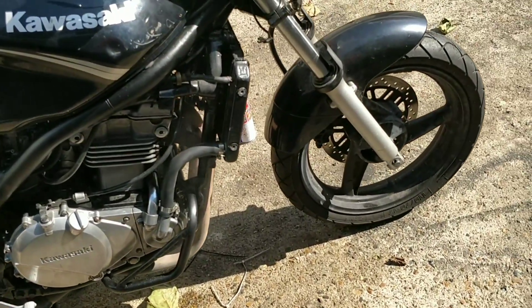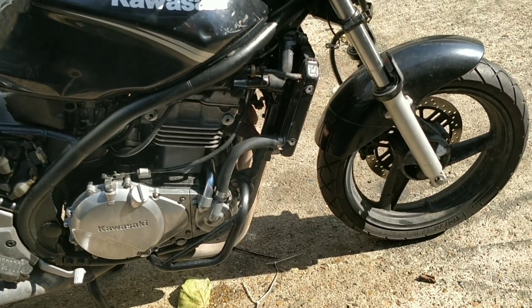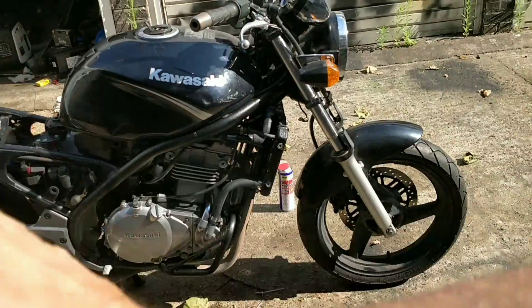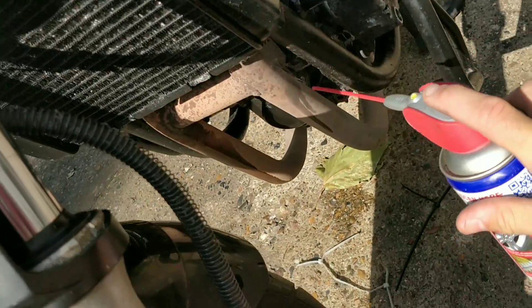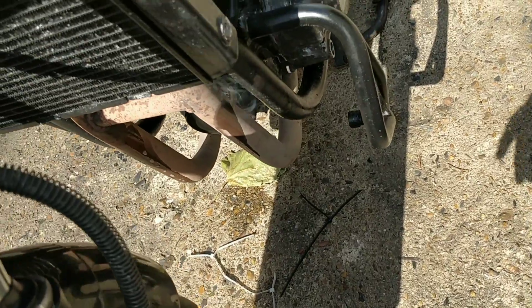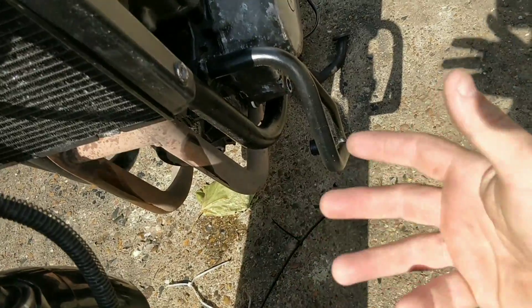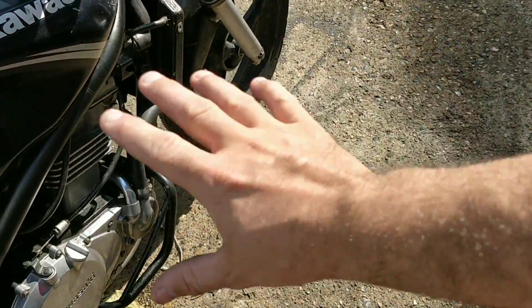I think that was running on one. Right side's hot, left side's not — so that's probably me just having pulled something. Let me double check that. It was running on two the other day. Running on one is good news — it means the circuit system is working — but there's a problem on the right-hand side. You see me do this a lot but people don't really fully understand it. See how hot that is? Now watch the other side — cold. What you're doing is checking the temperature, making sure it's sparking on both sides. I knew straight away by the fact that it didn't rev — that was your first sign that it wasn't good. Because it would be much smoother. But it's not bad news because it's just this side.